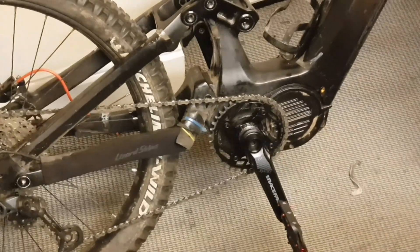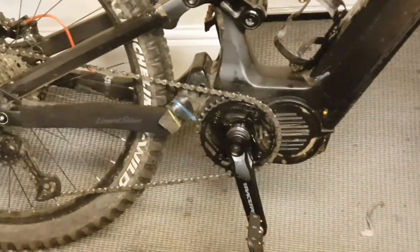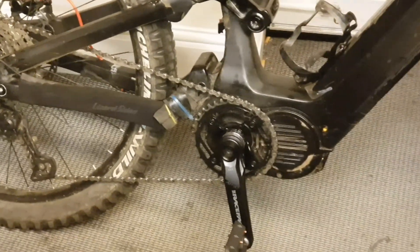Being cut for an honest review — the whole purpose of doing this was so the M620 on the E22 can gain a mechanical advantage so I'm not pulling as much power. And in relation to the comparison video between the Dengfu E22 and the E10, I can eliminate gearing as a variable — both bikes will have the same gear ratio, the same front chainring and cassette, and I'll make sure both are running the same wheel size so neither has a more favorable wheelset than the other.